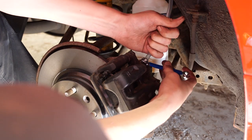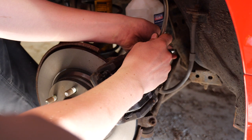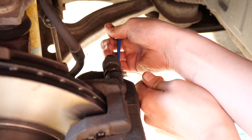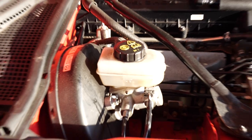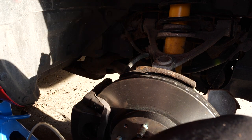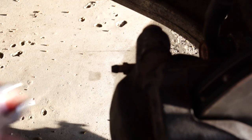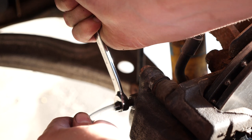Starting the bleed on this corner — flare spanner, hose over the bleed nipple. Best to have a clear quarter-inch hose so you can see what's going on. Down and up — a little bit of air came out of that one which is good. Fluid level getting a bit low so adding more fluid. I didn't go for braided brake lines — the performance gain is apparently negligible, it just removes a bit of sponginess. You can see this nipple is slightly bigger than the others, which means someone has changed it at some point.